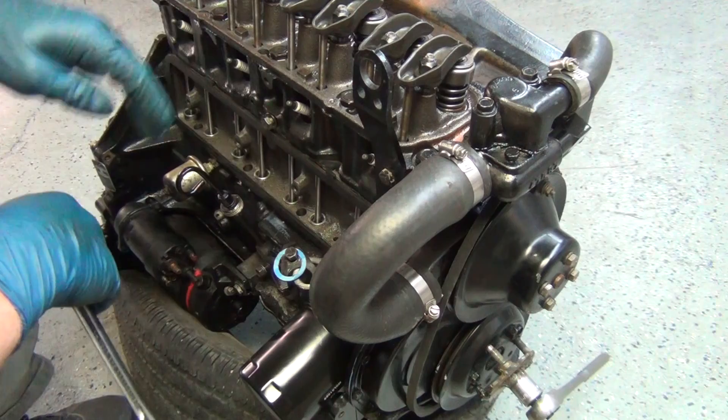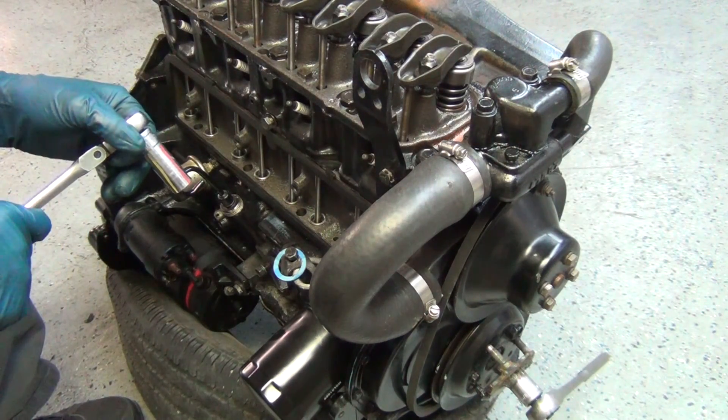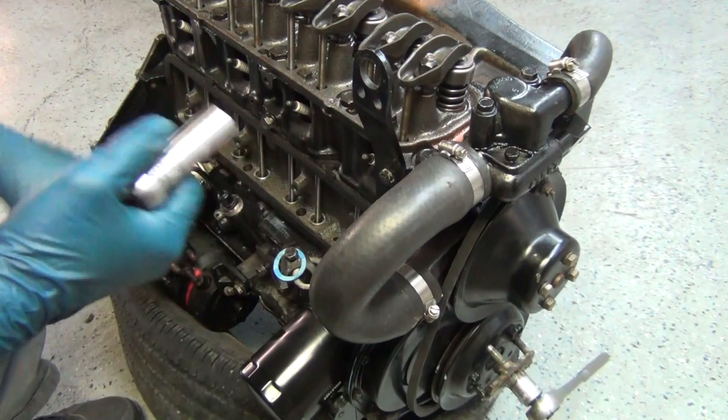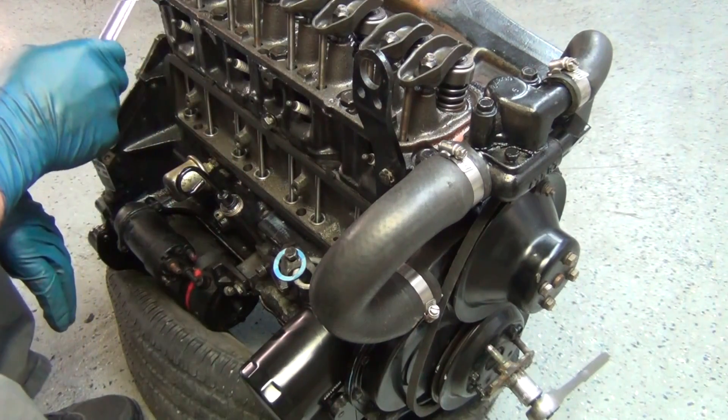That's where it gets its name, engines like this. These are adjustable — you can get them just the way you want them. And you do it kind of in the same way that you do with an overhead cam engine, meaning you go with the firing order: one, three, four, two.